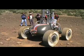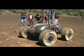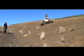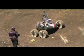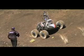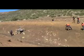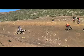As a result of having the ability to change its chassis and posture itself, we're able to climb very steep slopes. What we've been doing here today is climbing this steep, soft material — it's about 14 to 18 degrees slope. The vehicle can lean and posture itself, essentially climbing the slope by doing switchbacks back and forth up the hill, getting up a grade that you couldn't climb unless you had a very high horsepower vehicle, which of course we can't produce for the moon.